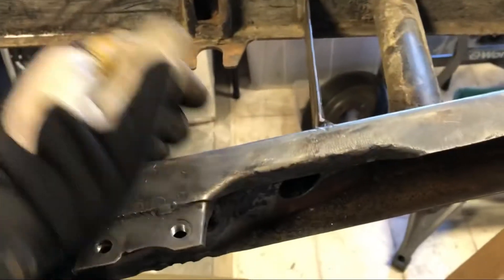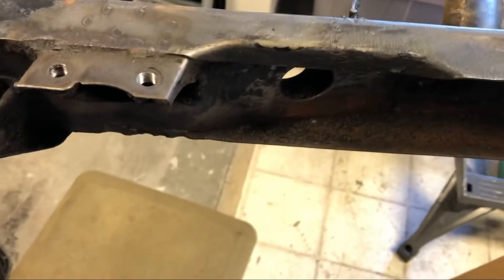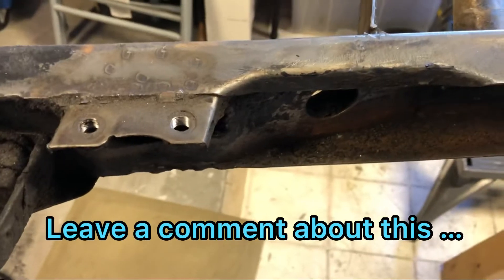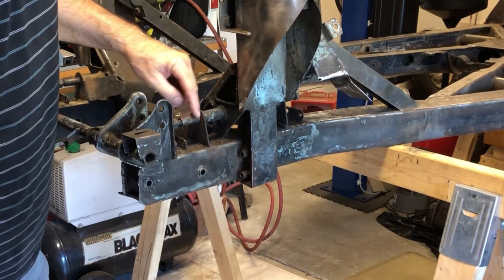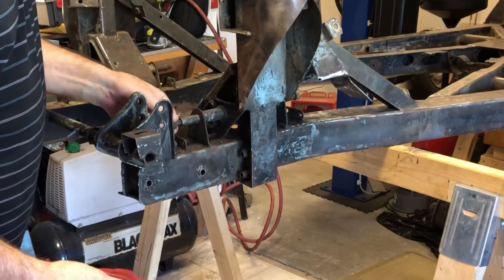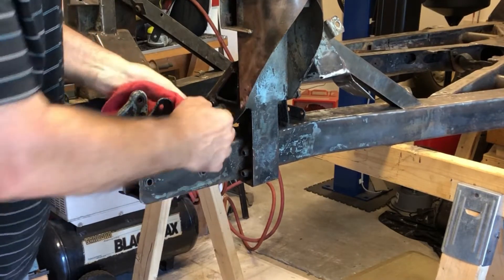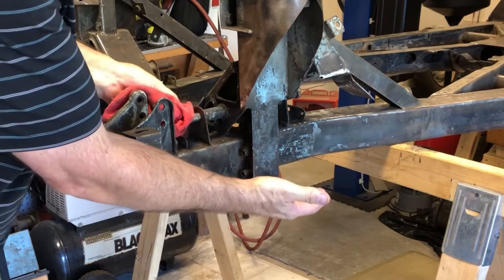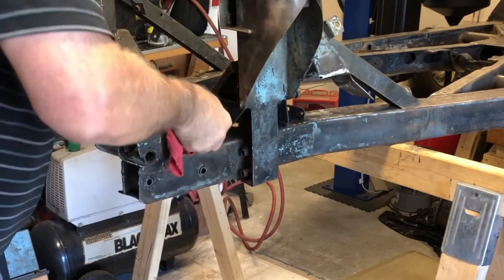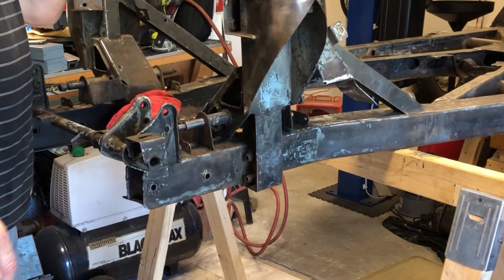Part of the reason I did this is so I could get to that rear hanger — I'll get those popped in. Right here looks like it's kind of folded over; I don't know if I need to straighten it out or cut it and straighten it out — let me know if you don't think that's gonna hurt anything. A guy on one of the forums told me to make sure I don't get these sandblasted or painted, so I need to take those off. This is where the lower portion of the A-arm connects, and this mount I did the repair on is where that stop sits. I want to make sure I clean these up and take them off so there's no extra wear and tear on them.